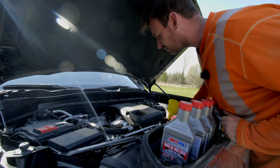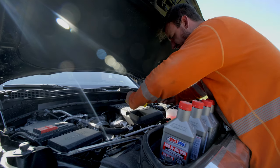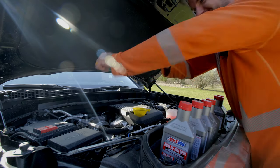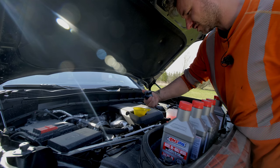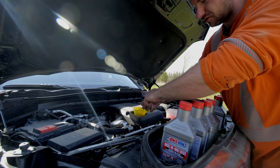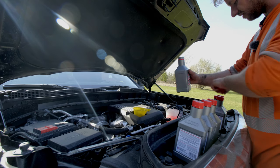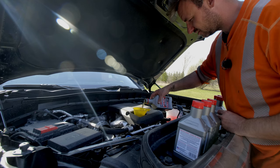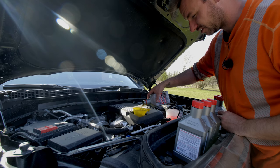Wow, this is quite the setup with the turbo right there — definitely a different engine. Get yourself a stepladder if you're on Rhino ramps. Get your favorite funnel ready. Right on the cap it says 0W-20 Dexos D — make sure you've got Dexos D because regular Dexos 0W-20 is not going to meet the spec. You need seven liters. Drain bolt's on, oil filter's tight — man this stuff flows.